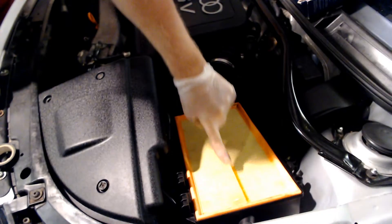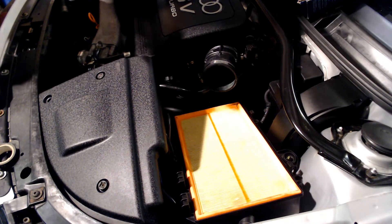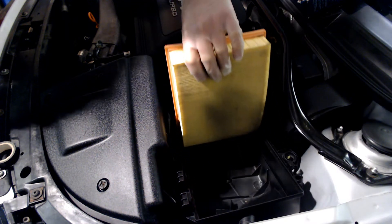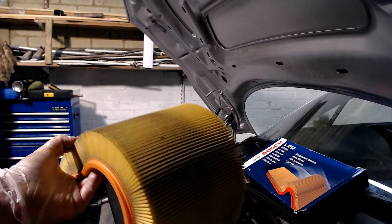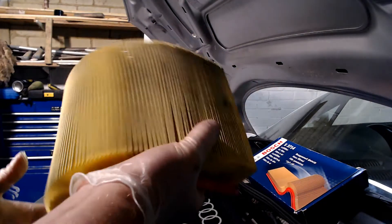So now we can clearly see the air filter - looks quite grubby. I have already taken this out once when I've been doing the engine bay. Remove it and grab a hoover - clean all this dust and dirt out of it. There'll be lots of bits of leaves and dust in here. Looking at the filter, this is the old filter and you can see it's done its job - it's dirty.